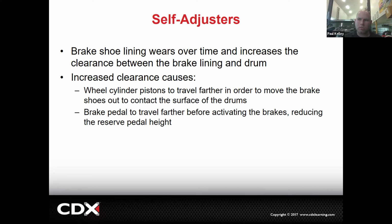So let's say a car comes in, and I've had this many times, that typically it's the front brakes that need to be done because they do 70 to 80% of the stopping. So if it comes in with worn pads, and I replace the brake pads and resurface or replace the rotors, depending on the condition, then a lot of times, let's say it's got 70,000 miles, I would probably take a quick peek at the drum, at the shoes. And if the shoes look like they're still usable, I'd actually sell a clean, lube and adjust as well. And I'll pull the drum off.